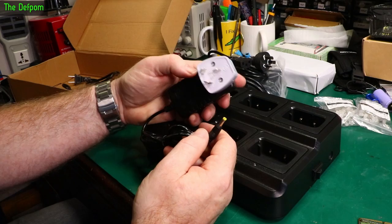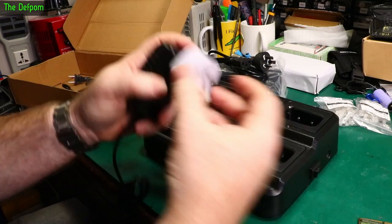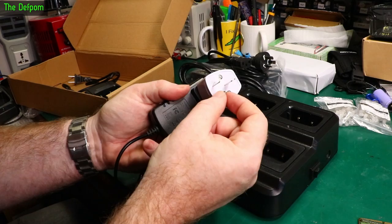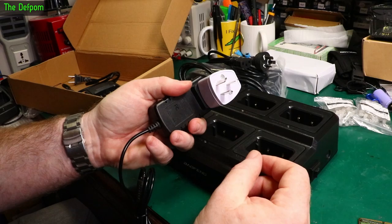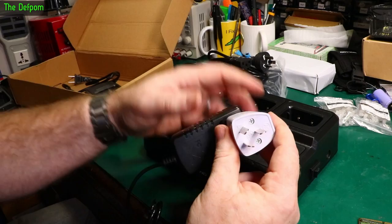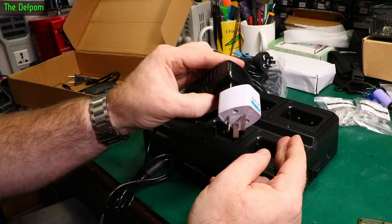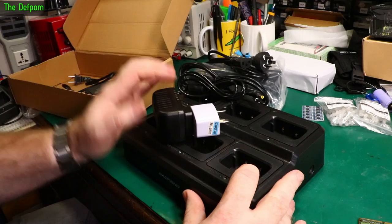I absolutely recommend you don't use them if you can avoid it. But in my case I'm going to use it for a short period of time — a couple of hours or so, under my supervision. This is one I've actually made a bit better fitting — that doesn't want to fall off. For the other ones, the plug literally falls off. The other part of the problem is these pins here — they're a little bit thin. In the actual contacts in the New Zealand sockets, they expect a slightly thicker pin, and so the actual contact gap might be too much. If I put this into a power strip, that's actually a loose fit — it bobbles around, has a bad connection. And if you've got bad connections, you're going to start a fire — very likely from the arcing. So I absolutely say don't use these things if you can avoid it.